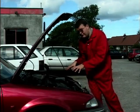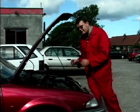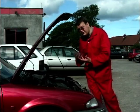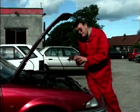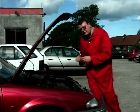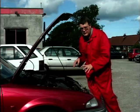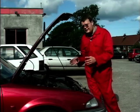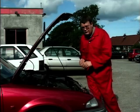You can't really stop yours from failing at the moment. However, when you come to get it repaired, you could get a new modified Rover gasket fitted, because Rover have recently brought this out with special oil seals that will hopefully prevent it from happening again. You don't necessarily have to take your Rover to a Rover dealer, but do insist that your local garage fits one of these modified items — that way, hopefully you'll only be getting the job done once.